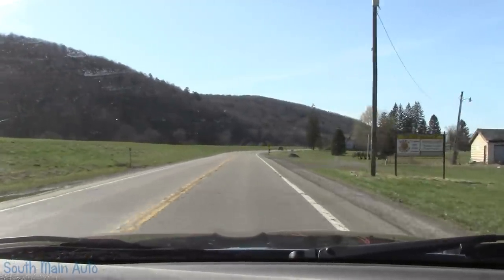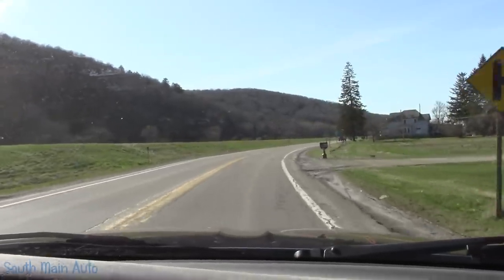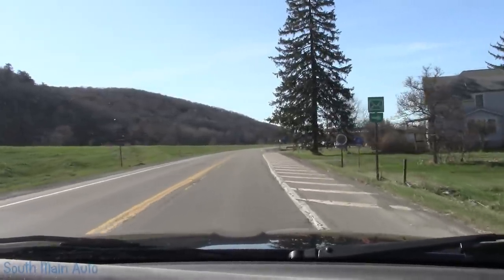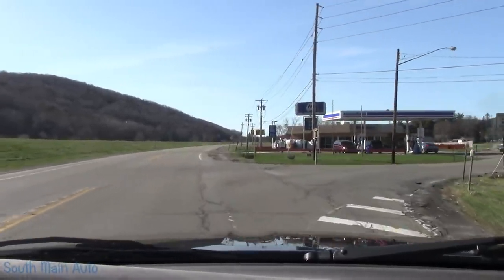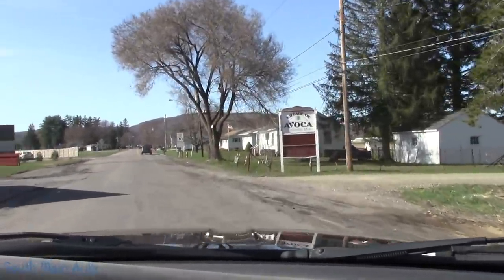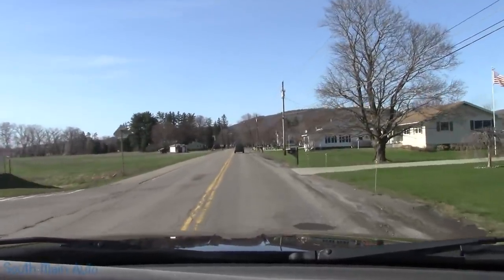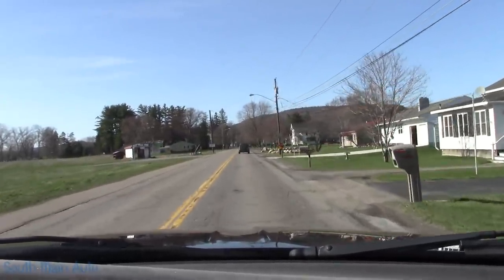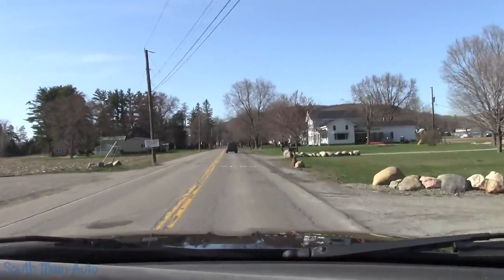Hey, you got a hot one? Hear that? It's a pretty good indicator that you have a pinion bearing going bad. You can see when you let off, it takes the load off. So keep that in mind for your truck when you're driving it around. Okay? Of course, Toyotas really don't have pinion bearings that go bad. Rear wheel bearings in the Toyotas, they go bad. You probably do that, right? No? No. Oh.